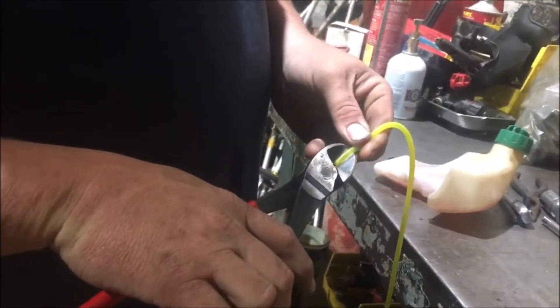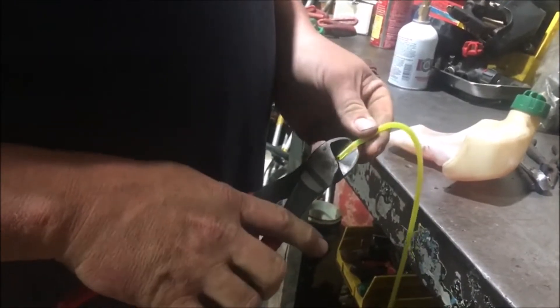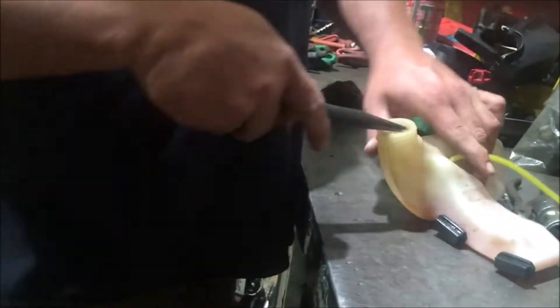You get your new fuel line here and this is the way I install it. Obviously it doesn't fit through the hole easily, so what I do is take and start cutting it - just cut the top off of it. Now if you look at the end it will curl a lot tighter. So we'll just stick it in the hole. Now that we got it cut where it'll fit, stick it in there and then I'm gonna take my pliers and stick through to get it going.